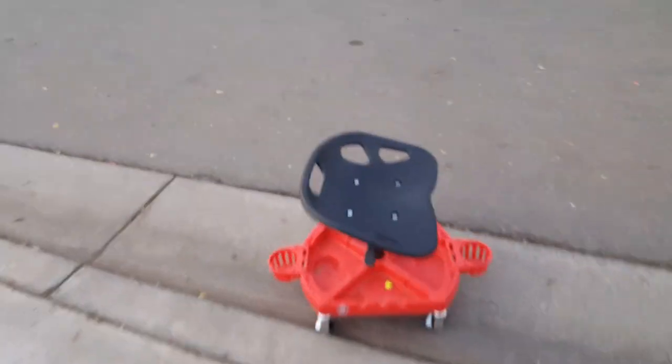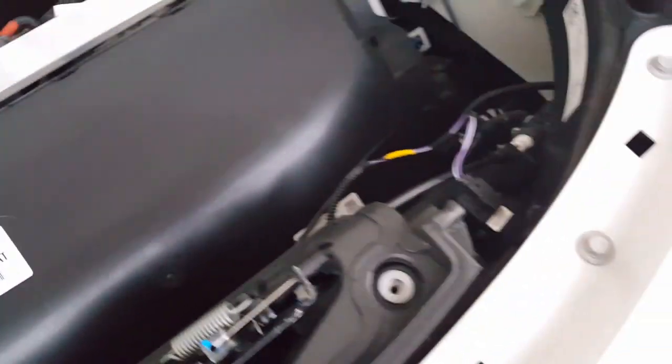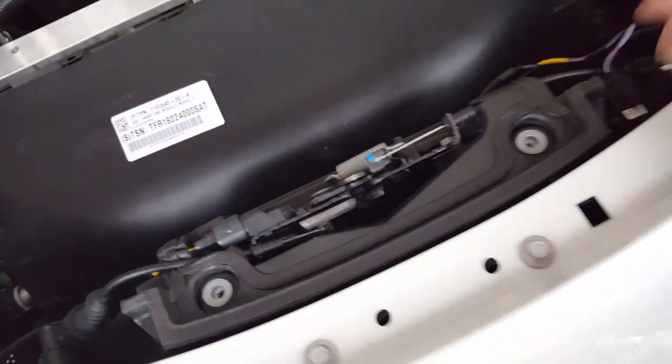This part I should freeze. Alright, here we go. There we go. Stay tight. Alright. Good thing these are a detailer's chair. They don't really scrape the bumper, which is a good thing. And if you did scrape it, since it's PPF, even a normal light scrape, even with a wire brush, will self-heal with the heat and sunlight. That's what's great about putting PPF on, especially for rock chips when you're traveling. A little expensive, but I think it's worth the investment, because I believe you have to repaint anything on a car, usually a couple thousand. So it's worth it to at least get the high impact areas.